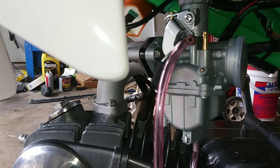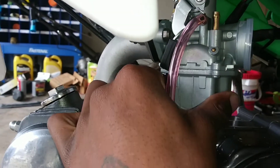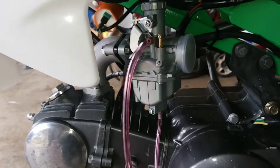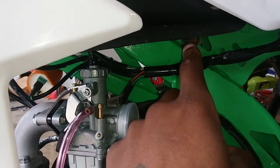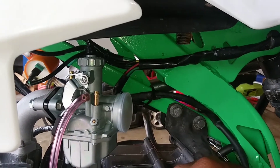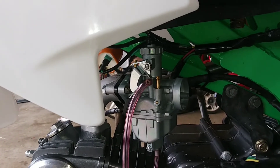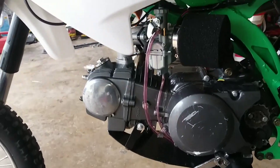I was able to find a bolt that fits. I had to push really hard because barely any thread was coming through, but we do have a bolt on there — carburetor is secure. I just need to find one more nut for the other side. Throttle is really crisp. Last thing to do is get the air filter on. We also need to figure out the petcock situation — all the ones I looked at are 13mm, so this tank is probably 15mm. Let's get this air filter on and the install will be complete.